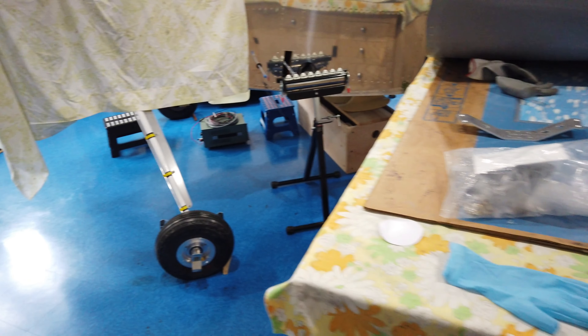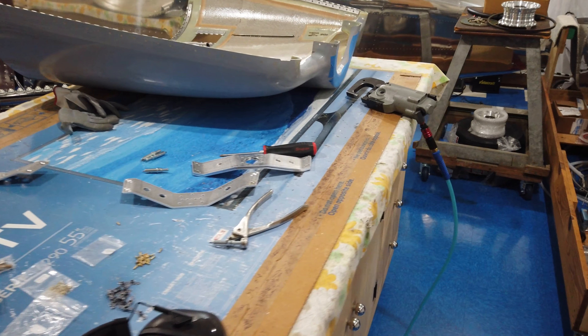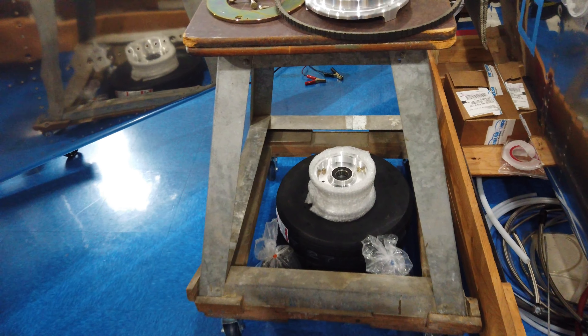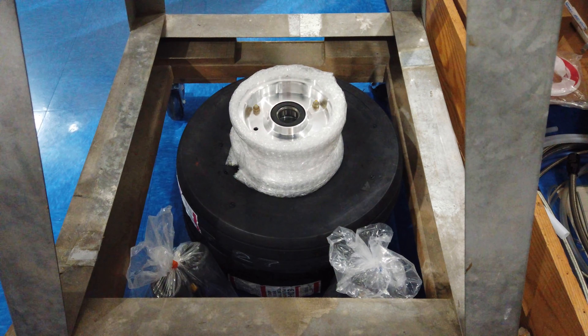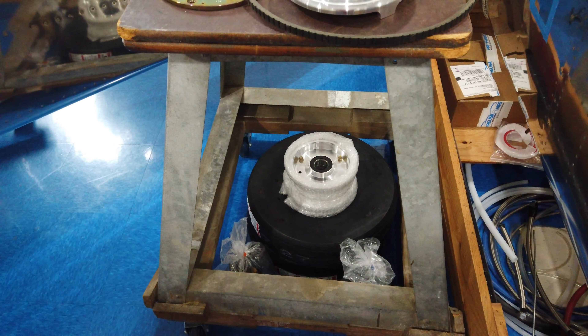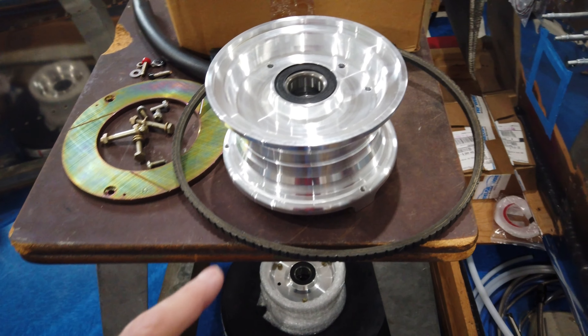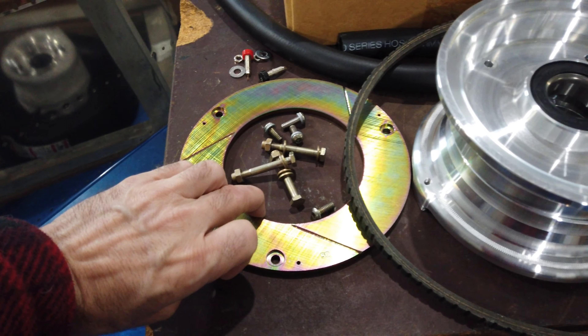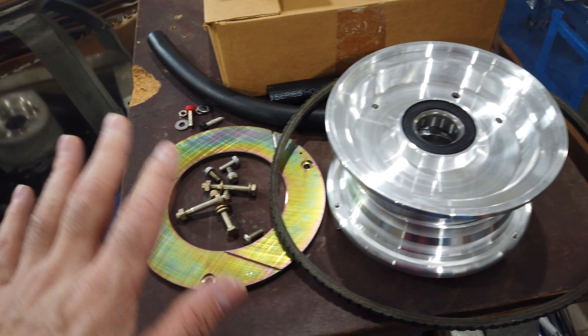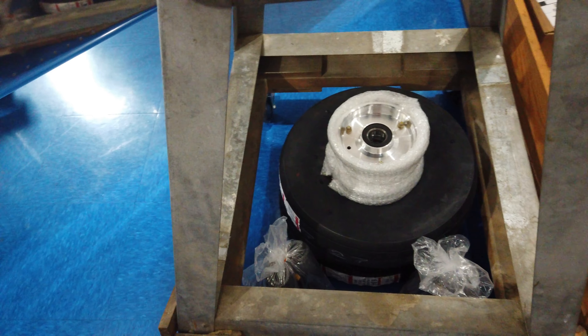I've decided I'm not going to keep any of that — I'm going to start over from scratch and go with some aftermarket parts. The first thing is I'm going to a larger wheel, larger tire, and larger brakes. These are Matco wheels and brake assemblies. I'll show these parts in more detail when I get to them. Right now I just have everything out of the box. These are six-inch wheels, just like the smaller wheels that come with the Van's kit but a bigger size. This is the brake rotor, which is different from the smaller brakes supplied with the Van's kit. The tires are bigger — these are six-by-six tires.